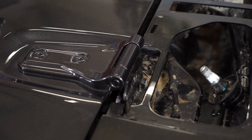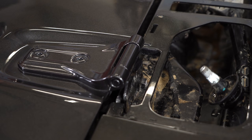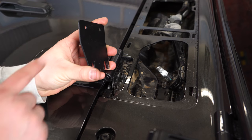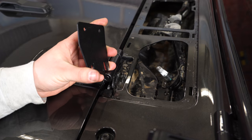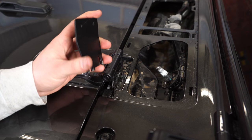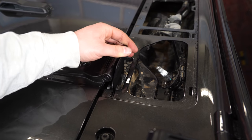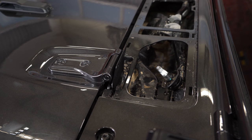On the inside of the hood hinge right behind the cowl cover, there are two 13mm bolts — go ahead and loosen them up. Do not completely remove the hood from the hinges; we're going to slide the bracket included right in between there. Grab the included bracket and make sure that the angle faces back towards the windshield. It'll give you enough clearance behind the back of this hinge to mount the other bracket onto it. Slide it in between the washer and the body — it'll fall nicely into place — then get those two bolts tightened up.